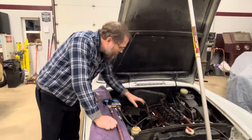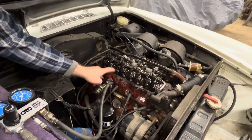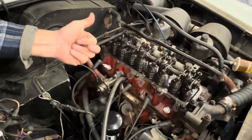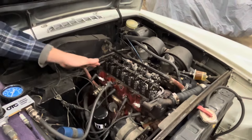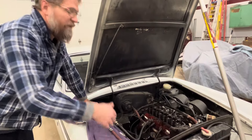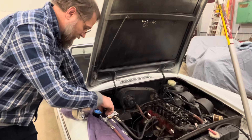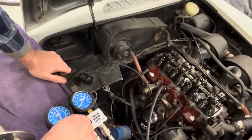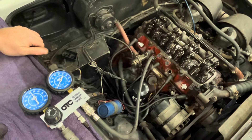To verify a blown head gasket, we get one of the two cylinders up on top dead center with both valves closed, car in gear, and then start introducing air into the cylinder. I've got a leak-down tester, but you don't really need one — you just need air. Just don't use 150 pounds of air pressure because the car could lurch forward. You just want some air going into the cylinder.